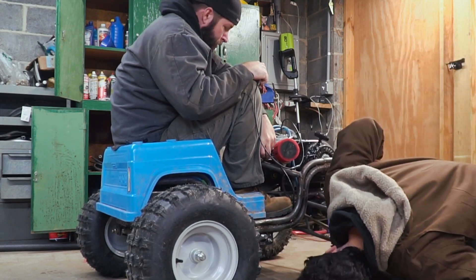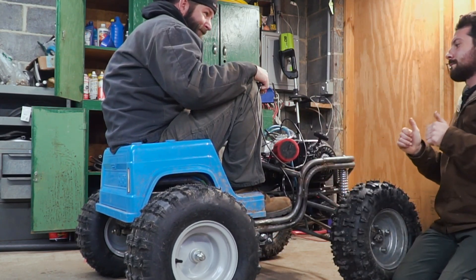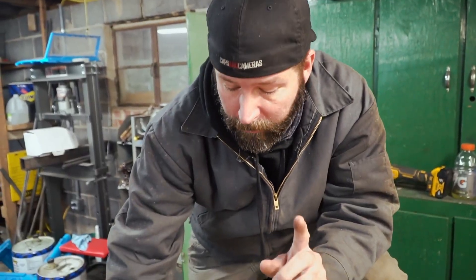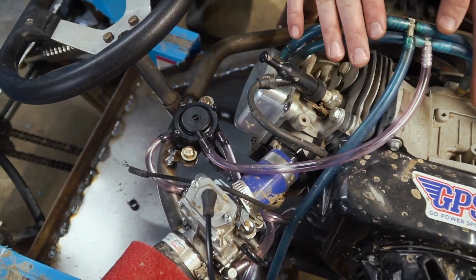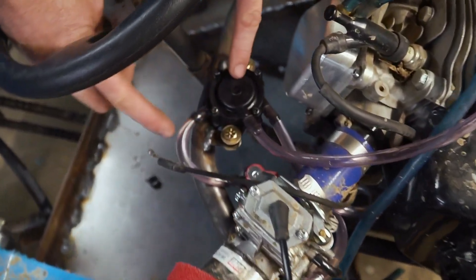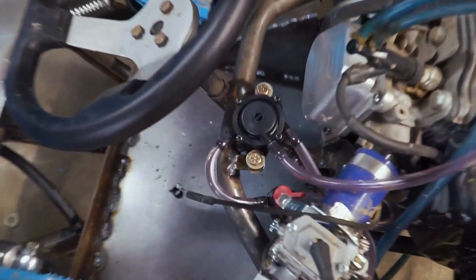That's awesome — that's good flow. Pulse pump works. It works like a dream. A little bit of advice: this line goes to a pulse, which we're using the crankcase in this example. This unlabeled line goes straight to the fuel tank. And this line that's all by its lonesome goes from the pulse pump all the way to the carburetor. Different pumps vary with manufacturers, but this is the way this one works — the Go Power Sports Pulse Pump, that's how it works.